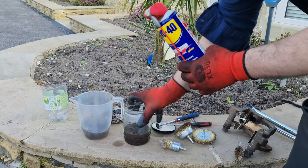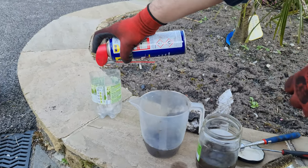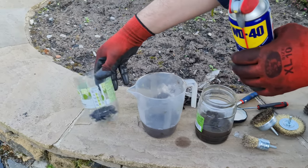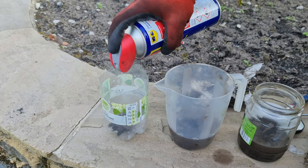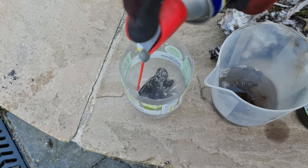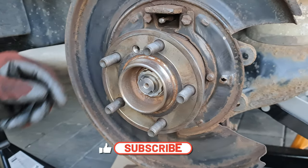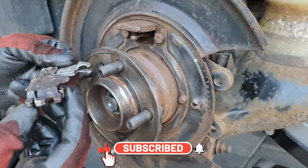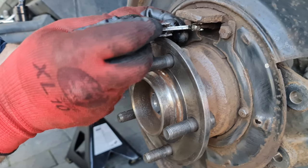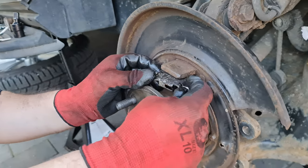After the second stage — first stage is super dirty, then a bit cleaner. The last step is I need to restore some lubrication, so I'm going to put WD-40 here and add more on top. That will restore some lubrication. Now let's assemble this one first. There's a cable here — you hold this one from the inside and get the cable in like so, and put this one in like that.